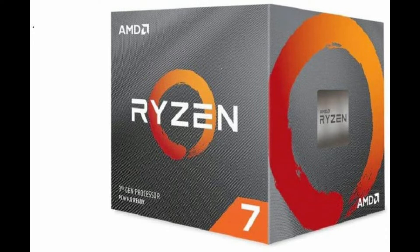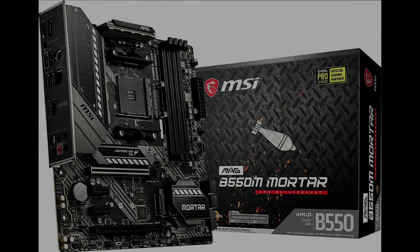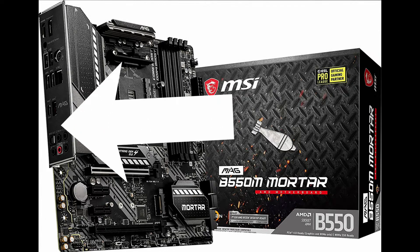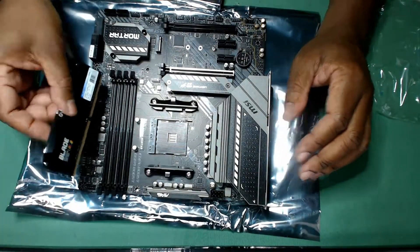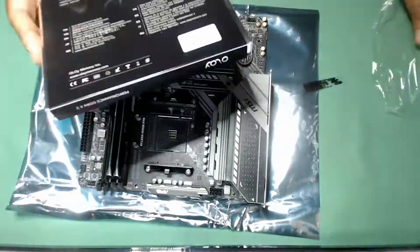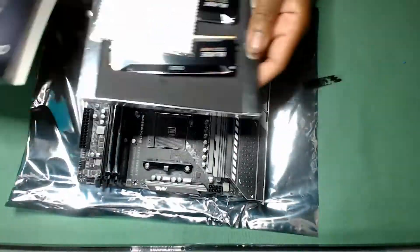As a result of this CPU change, I decided to use a more robust motherboard — something with better voltage regulators to handle the increased performance from the higher-end Ryzen CPUs like the 3800X. The Bazooka's big brother, the Mortar, met all the requirements and most importantly has the I/O panel integrated. Another benefit is that it also has a second PCI Express x16 slot. And since the Mortar can control RGB memory modules just like the Bazooka, I decided to put four RGB-capable memory modules into the motherboard, as four modules would allow me to reach the memory speeds I was looking for while guaranteeing maximum stability.